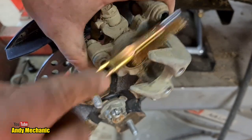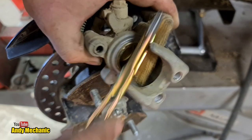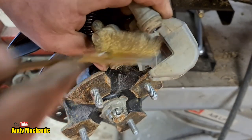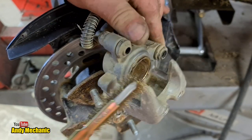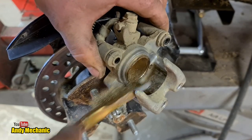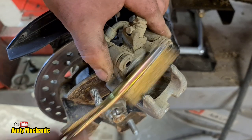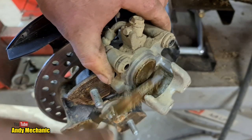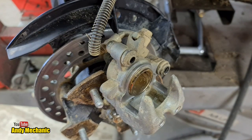We're just going to clean off the dirt around the piston. A brass wire brush is great for this job because it doesn't cause any harm to the seals and the rubbers and stuff, but it's still strong enough to get in most places and get all the dirt out. It's not going to take the coating off the piston either because the bristles are so soft. Let's give it a blast out with the airline and we can stick it all back together.